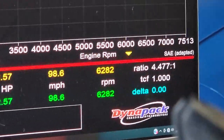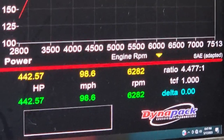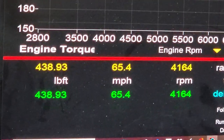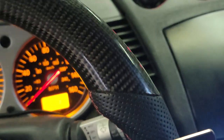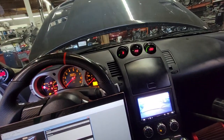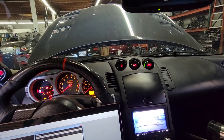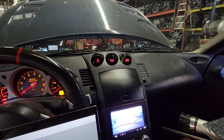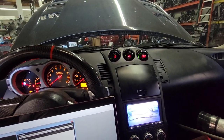I'm flashing this ECU. I do have the numbers — 442 wheel horsepower and 438 wheel torque on this car right here with the mid-mount. It is on E85. It has the stock fuel system, just has bigger injectors. This one has a dual tune — let me go back there and show you guys. Pretty sick.